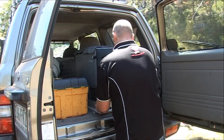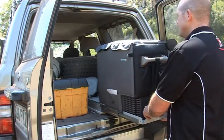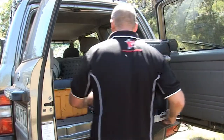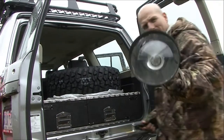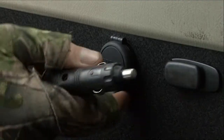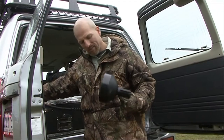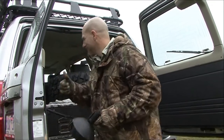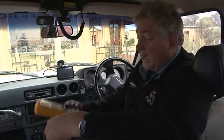The second thing we can also check to make sure that everything's working correctly is that the fridge is plugged in correctly via a good quality plug and socket, and also ensure that there is adequate voltage at the back of the socket. To check that, I just use an old headlight or an old driving light. I plug it into my fridge socket, which is actually going to load test the entire wiring system all the way through so I can make sure everything's working. I'll also show you, if you haven't got this instrumentation — which is not essential — how you can use a garden variety standard multimeter to work out what's going on.